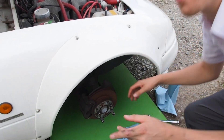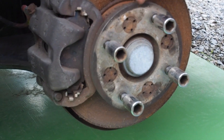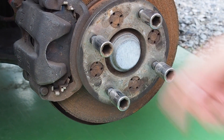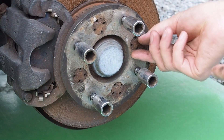In the meantime while waiting for the second set, I wanted to check the front wheels. I had assumed the front wheels would work, but take a look — they've cut the extra studs off. The original studs have been cut flush with the spacer, so if you remove the spacer you don't have any lugs to put your wheels on with, which is obviously a problem.